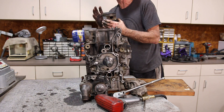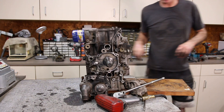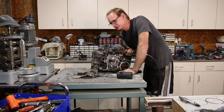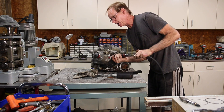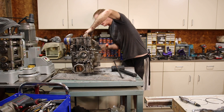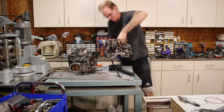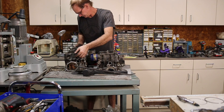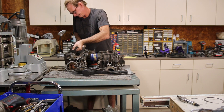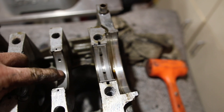We're going to reuse all the pistons — just doing rings and bearings. Lay everything out in position so you don't mix anything up. These block bolts were really on there; I had to use my three-quarter inch impact gun to get them off. Now let's take the crankshaft out — nice and straight. There we have it. Now we can take it all apart and measure everything.